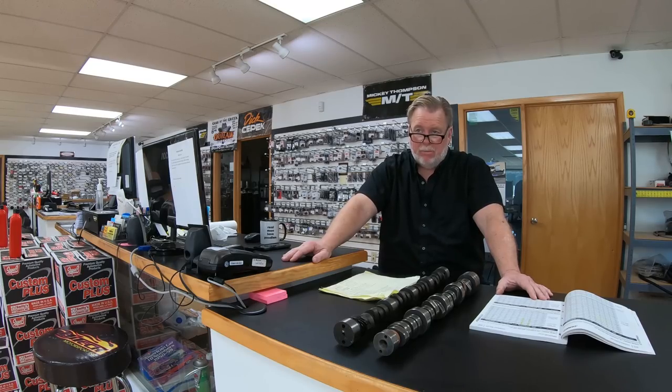When you get into something bigger — say a 408 cubic inch bored and stroked 6.0 — the LS1 cylinder head becomes really restricting. I did one in my own Corvette: we did get it to make 625 horsepower at the crank, but it was so fussy down low that even with a stick shift it was miserable to drive. The cylinder head was maxing out, not the cubic inches. We were hoping for better than 1.5 hp/cube. That build had a 242/252 on a 111 LSA — I don't recommend that. It only worked from about 3500 to 7000 RPM.